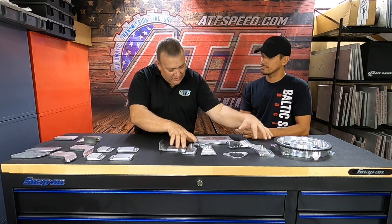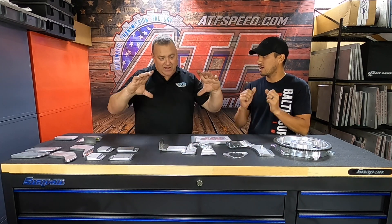That stress can damage the block, make your rings not seal, and cause a lot of blow-by — it's really hard on the engine. Once you put this mid plate in and weld it into the chassis, that thrusting of the engine at the back is eliminated, so you're not getting distortion of the cylinder walls or breaking the sides of the block. It makes things a lot stronger.